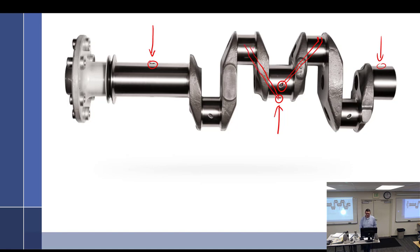You won't be able to see this on old crankshafts, but on a new modern one you'd look in there and see a steel tube — a little straw — and you never, ever take those out. The oil pressure feeds each crank pin journal. There's also another hole here, because we often put a plug here to separate the two oil circuits. This is the oil off the governor that goes out to the prop — it has to have a way to get oil to the prop.